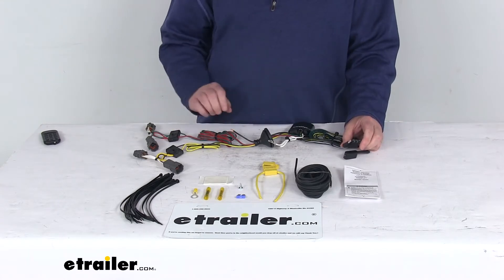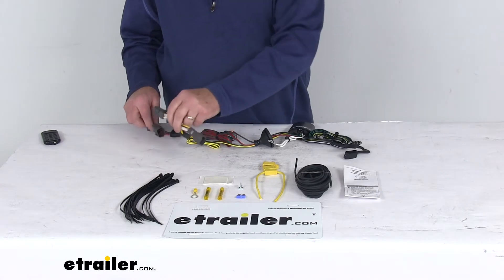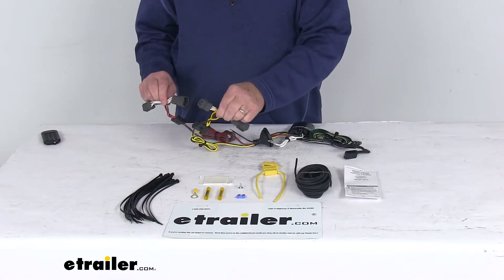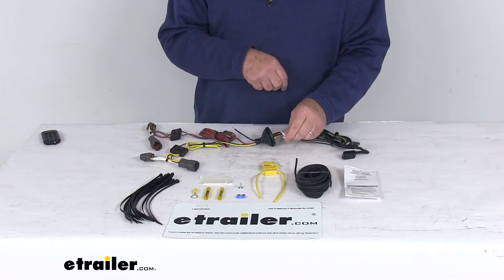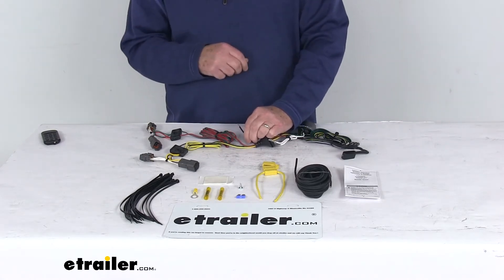This connects quickly and easily. Basically, you just locate your connection points, which will be behind the taillights on your vehicle. Plug in these T-connectors, one on each side — one on the driver's side, one on the passenger's side. Then you'll have your white wire here; you just ground this to a good clean ground. And this black wire is your power wire — that'll run to your vehicle's battery.